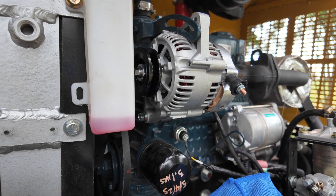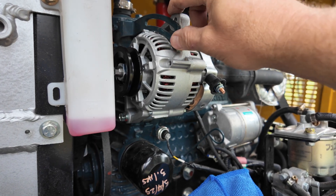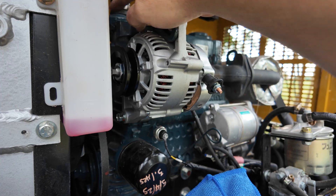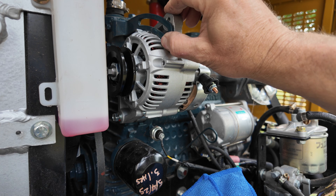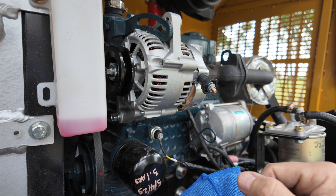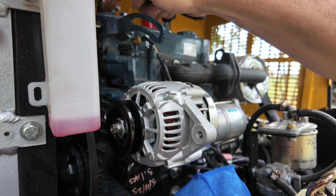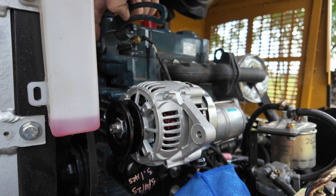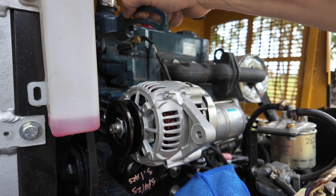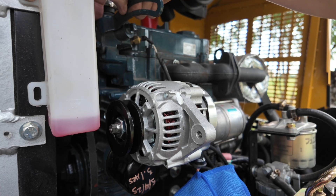The bolt is in, but I can see the threads sitting above the bracket, so I'm going to take this bracket off and see if it can be modified. I think all I need to do is swing it up a little — it's just two bolts on the upper tensioner arm, 10 millimeter. I don't think we need to change the lower hinge point; if I can just oblong this hole out a little bit that will get me enough height, maybe about an inch.